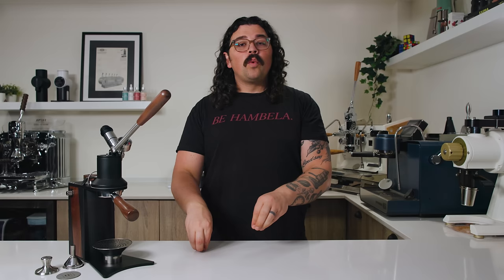Now, there are claims from some companies who think they have figured out how to stop this drifting of temperature in the group head. I've checked into these claims, and honestly, with the machines I've used where the claims have been made, I still see a massively drifting temperature in the group head. I've yet to see something that has effectively been able to keep constant steam pressure without overheating the group head with successive shots. So you see people taking ice packs and cool rags to cool down the group head so that you can continue pulling shots without getting into those rancid flavors from having too hot of water.